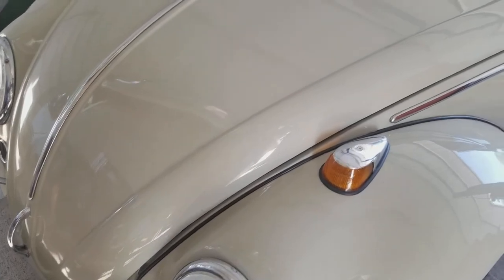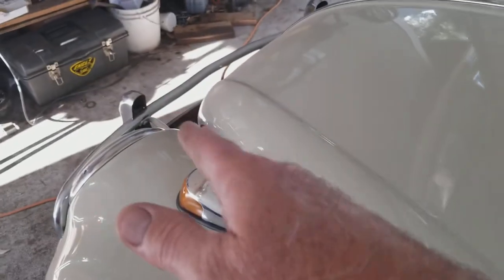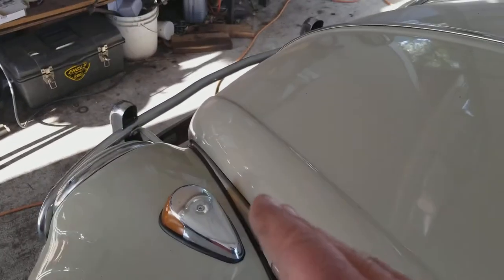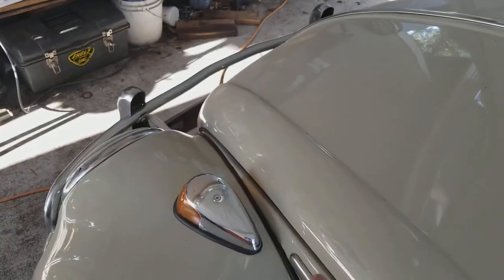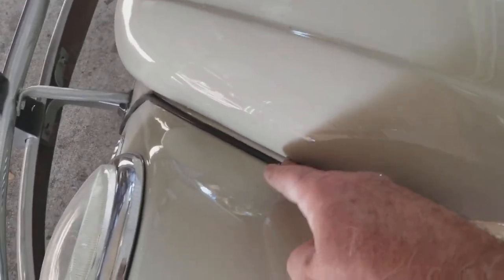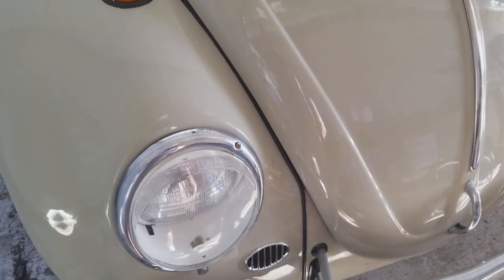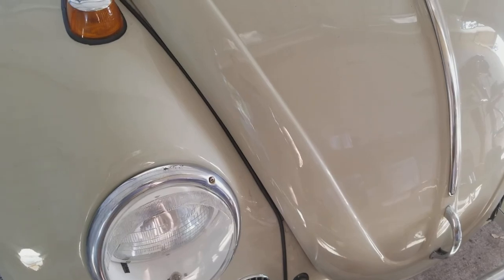So, to recap: adjust the slotted bolts first so the gap is even all the way across, then see what you need to tweak in the front. Remember, you might have to tweak the hood, you might have to tweak the fenders — with the fenders off it's a lot easier to do. Look at how that gap there is exactly the same. There's still a slight bit of difference, so maybe the hood's actually splayed a little bit. This hood wasn't even in that great of shape, but it just shuts amazingly. I'll talk to you guys in the next video.